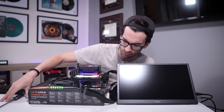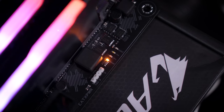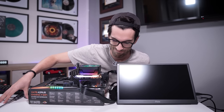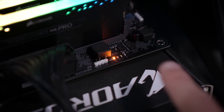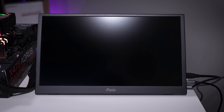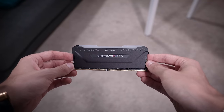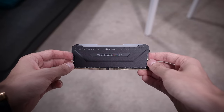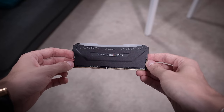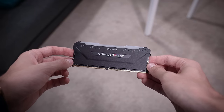So we are just looking for a post. And right away, the DRAM light is on — amber DRAM LED. I don't think we're going to get picture out. The same symptom we were running into earlier — it'll literally just sit like this, forever, no picture to the monitor. And just so we're on the same page, this memory kit I know works in other builds. I confirmed it again today with another system I already have up and running. I also tested the 3100 in another build. There's no reason to suspect that is the issue — we can pretty much narrow it down to the motherboard at this point.